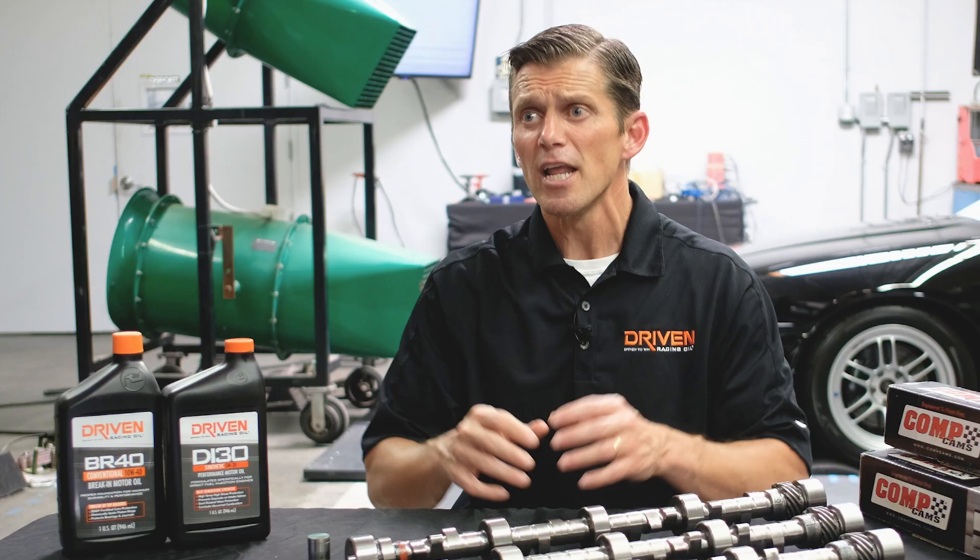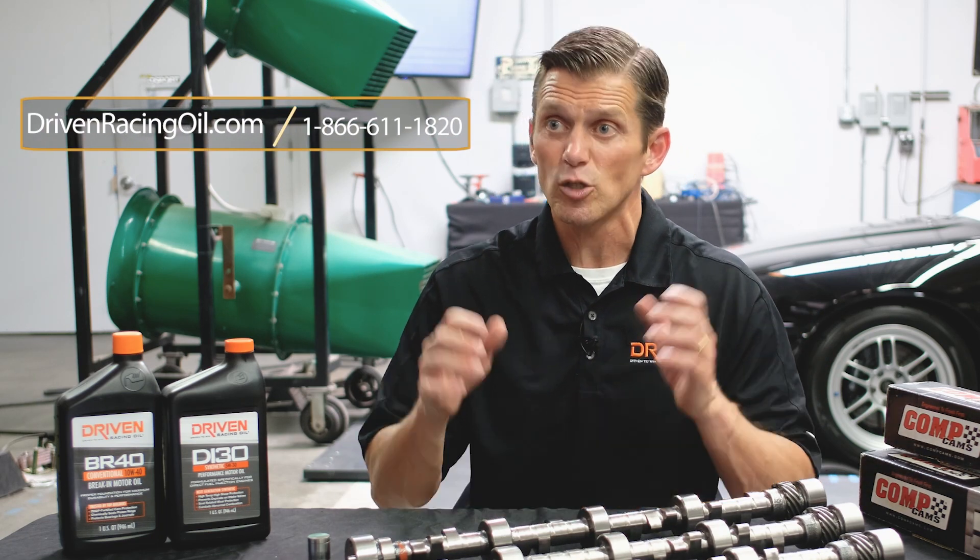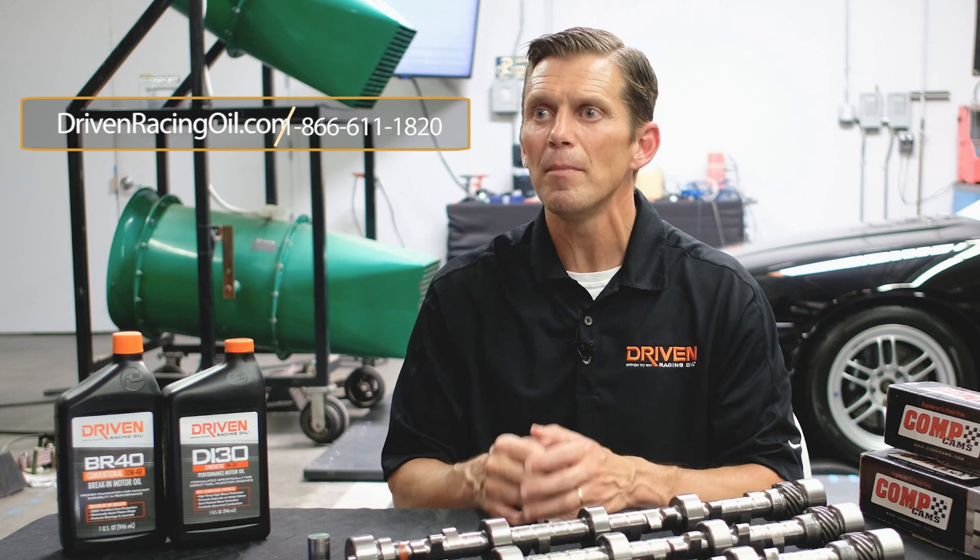Pretty neat results. The idea behind all of this is that surface finish and lifter hardness are variables you have to control because they have a direct impact on wear. You can't make oils that work better if you're not controlling all of those variables — and that's what we're doing. I hope you enjoyed this insight into how we go about testing to make better oils with better durability and more horsepower. If you're interested in learning more, please visit our website at drivenracingoil.com.